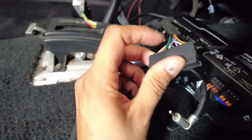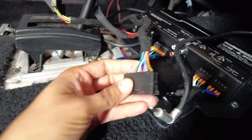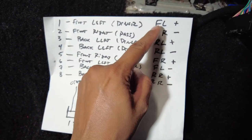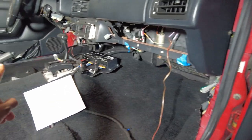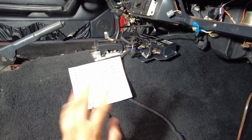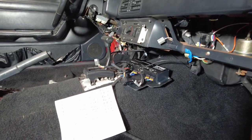But what do you do when your speakers are not transmitting correctly? And it's an easy mistake because at the time, in the 90s, I guarantee you they were drunk when they were assembling these cars, because my pins were wrong. When I originally checked my pins, this is not the colors that they were. This was the situation I ran into — right there it sticks out like a sore thumb: front left positive, front right negative. That should have been front left negative. So my front speakers' negatives were off, meaning they always sounded bad. That's why the previous installer completely bypassed them and went straight to wiring up to the rear speakers, completely ignoring the problem with the front door speakers.